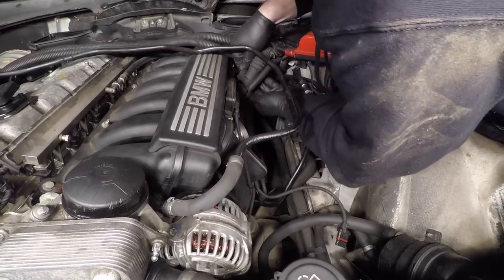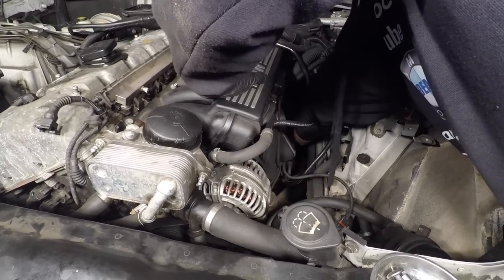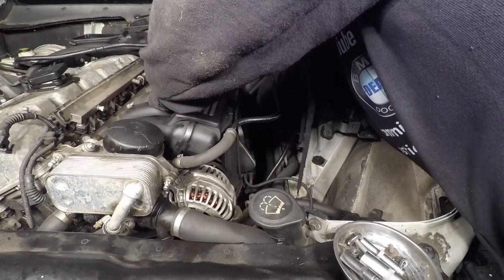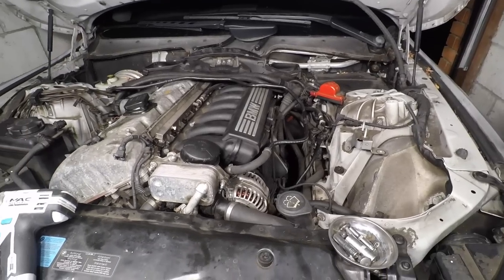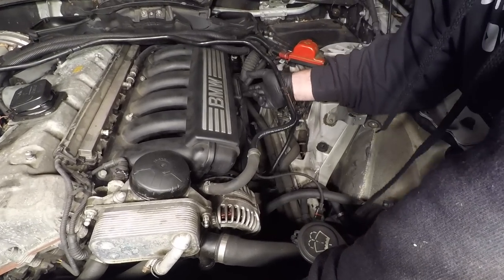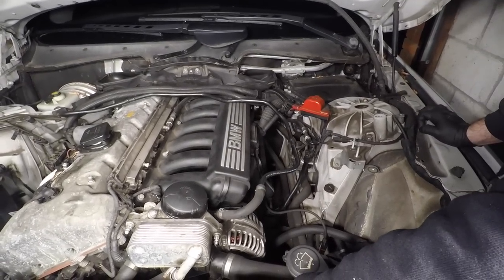Reconnect the electrical connector here and replace the remaining hose. Go around and inspect all the wires — make sure nothing's trapped, caught, or hanging out. Make sure everything's tight, all wires are in, the PCV is seated properly, and all wiring harnesses are connected. You've only got one gap which is for the top hose. I was going to show you how to reconnect the air box but you've seen that on my other videos. Remember to put the oil pressure sensor switch back on. Thanks for watching, guys — this is BMW Dr. Dean. If you like this video please like, share and subscribe. My next video will be about the valve cover change on this car. Goodbye.